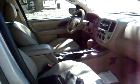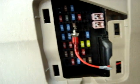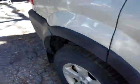First I'll show you where the fuse is, if you want to check yours to make sure it's not just that. Right on the passenger side here there's a little compartment. That's the fuse right there, 10 amp, number 21. The cover's on here actually, sorry. So it's just a cover, pop that off and you get exposure to the fuses. If it's not that, you can come back here.